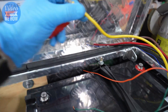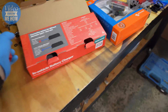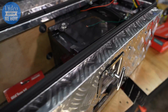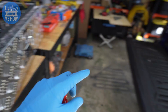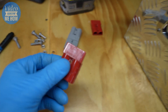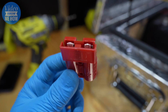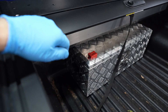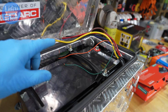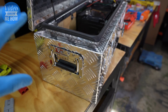We're going to do exactly the same thing with our yellow wire, which is our solar input. One of the really cool things about the Redarc unit is that it has a built-in solar MPPT controller. When I'm parked up camping on the beach, I want to be able to pull out the solar blanket which has a red Anderson plug on the end. The benefit of these is they're not interchangeable — you can only plug solar into solar. We'll use one of these on the outside as well, so I can plug in the solar without having to open anything up. We'll do the same with the earths and smaller wire inputs so everything will be fully closed up — just plug, plug, and it's ready to roll.